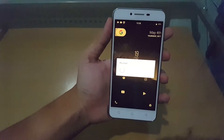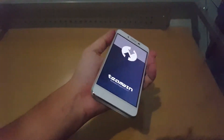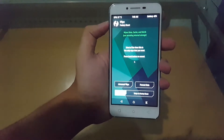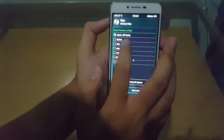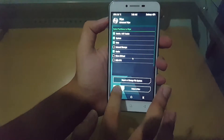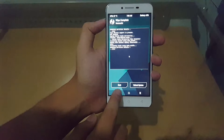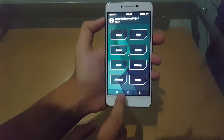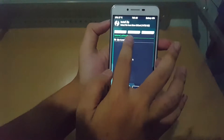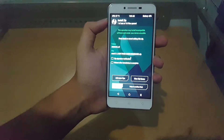He tested this on a bunch of Samsung devices like the S5, S4, S3, and some other Samsung devices, but this is the first time I'm trying it on a non-Samsung device — the Lenovo K5 Plus, A6020 A46. It's asking me for a factory reset, so I'm going to do a factory reset — dalvik, system, data, cache, and cache. This is the first time I'm going to try this mod on a non-Samsung device, so I'll add it to the list to show that the ROM and mod actually work on other phones. I'm going to install Omni 7.1.2 — I do not recommend installing this ROM on the Lenovo K5 Plus.